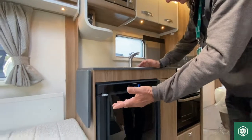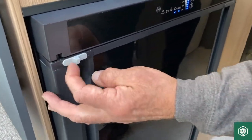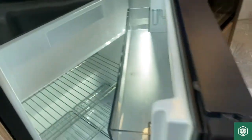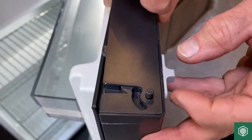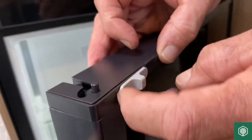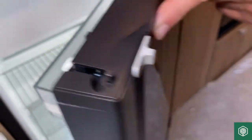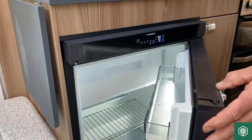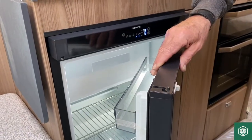The only other thing is now just to open up the refrigerator door itself. You operate it by moving it rearwards — you can see it's slightly spring-loaded — so you just move it like so to open up the refrigerator. On top of the fridge door itself, you can hold that trigger back by moving it one more click, and it no longer protrudes out. So therefore, what you're relying on is a magnet to keep the door closed, which is what you'd use probably when you arrive on site rather than having to keep on causing the catch to release.